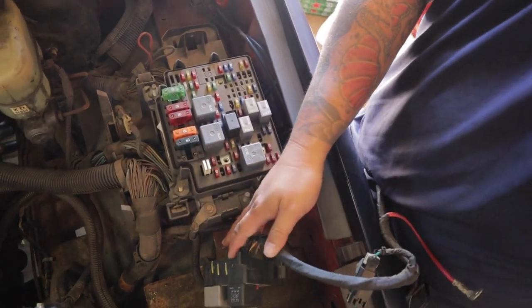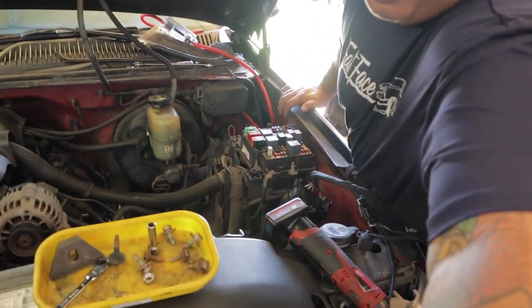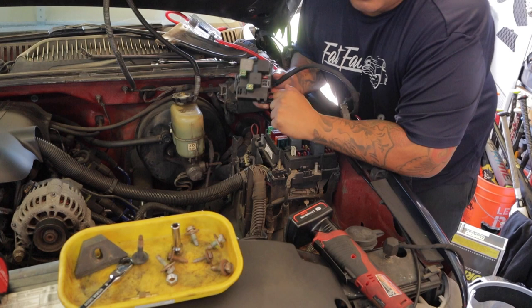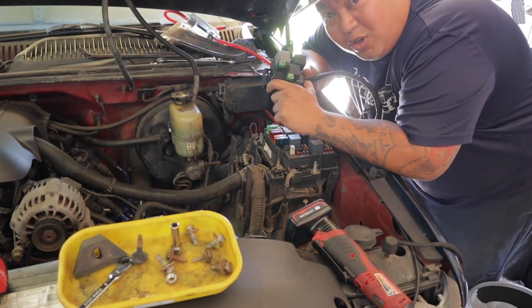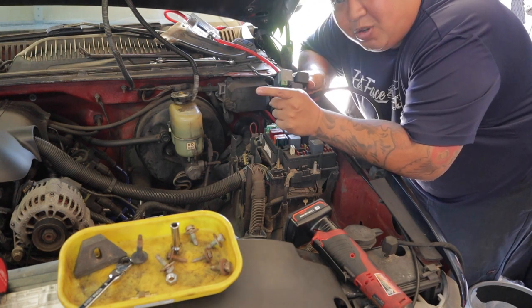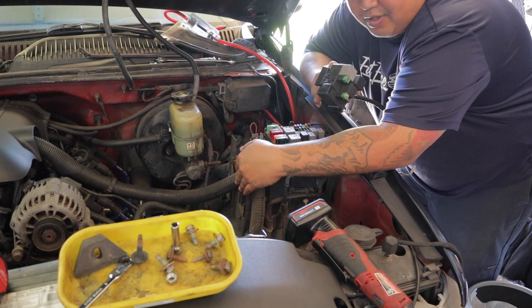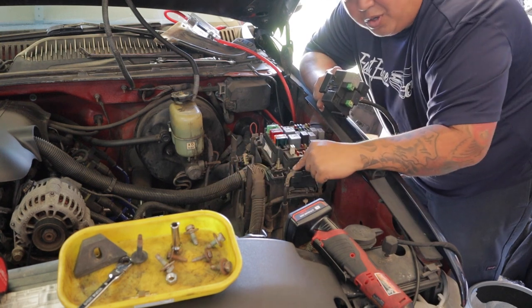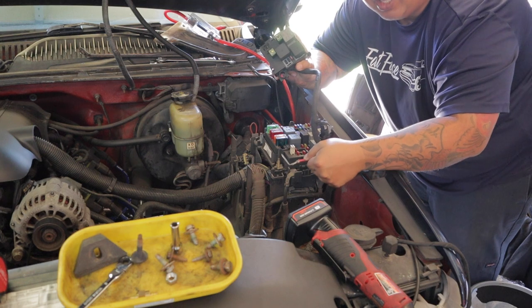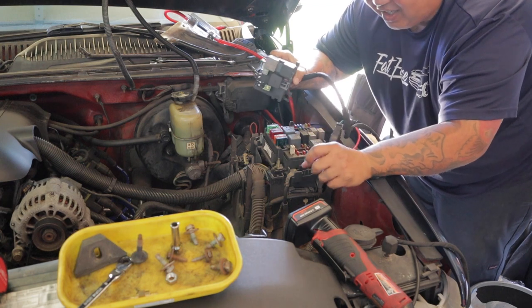Like the whole theme of this video. Now, if you just buy any of those three-relay harnesses from Amazon — I'll link one in the description — you don't have to take this whole thing apart; you could just mount it to the outside of the cover. But this is where you want to mount your main power, so this cable is going to go here.